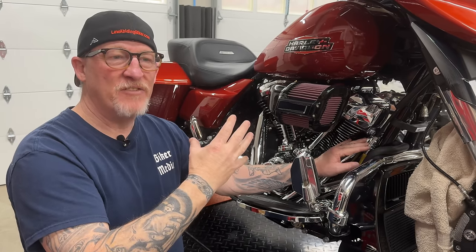Walking back over to the 2024 Street Glide here — I'm showing you all this in case you're going to keep your cable clutch system and need to know how to adjust it. A lot of guys will, and it's expensive to convert to hydraulic. Our adjuster is at its loosest position right now. You're looking at about a half inch from here to the ledge on the lever — that would be way too much; you'd probably start your bike and it would jump on you in gear. I'd like about an eighth to max a quarter inch of play. I just know by feel, but I'm using the tape measure to show you. Then we can get out on the course for cone drills, making finer adjustments with the bike running.